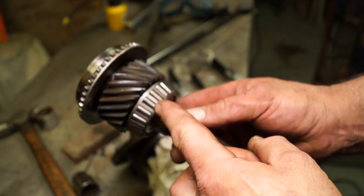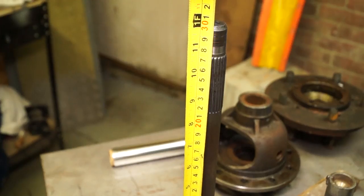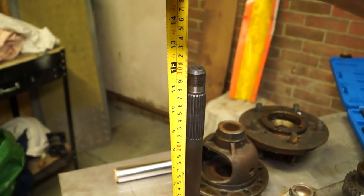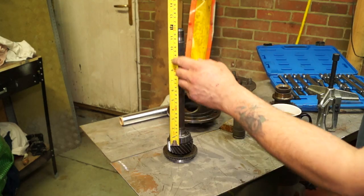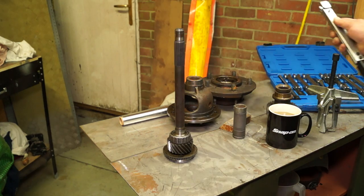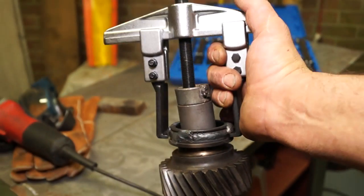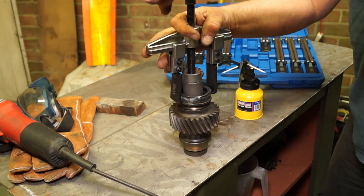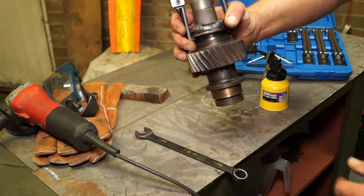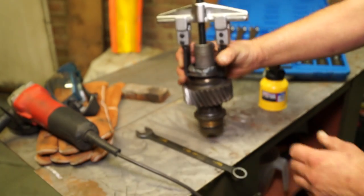You just got to be aware not to put too much heat in it. Something like this obviously has issues because of the length — the input shaft of the R380 is about a foot long, 300 millimetres, 30 centimetres — and you need legs that are just a bit over. Unfortunately the kit I have won't do it, which is a pain. Another tip: if your bearing goes on the piss it makes it more awkward to pull — the whole idea of using a puller is to pull it evenly. You can actually see that the leg is not evenly distributed. Once you pull it a little bit you can get the legs underneath the bearing race and then pull it the rest of the way evenly.